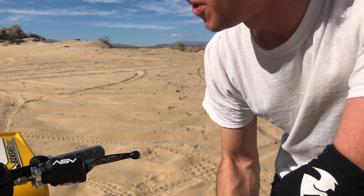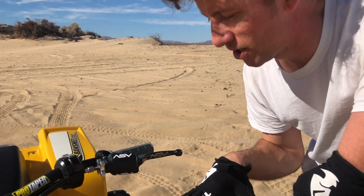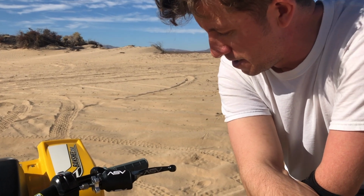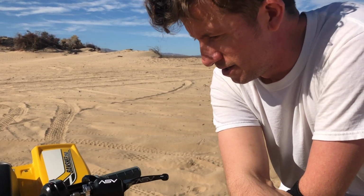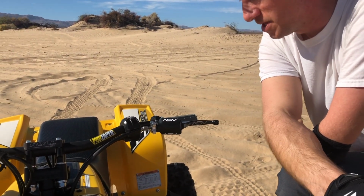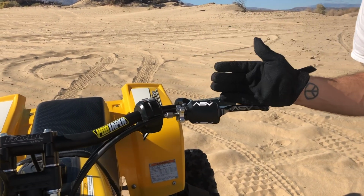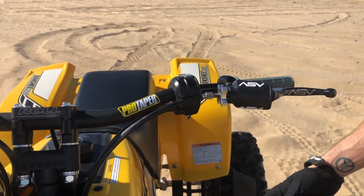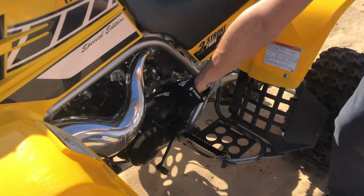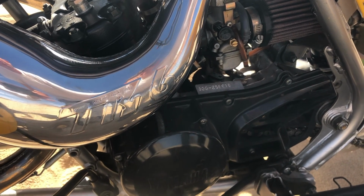Like I've been riding it. I rode it from my brother's house to here. It's about 20 minutes. It's been working fine, and now it's starting to kind of mess up a bit. It's really hard to grab neutral for some reason. I'm just wondering what the issue could be, because it was perfectly fine when I had the stock bars, stock lever, same clutch cable, and if you look, everything is functioning pretty perfectly. The clutch is definitely grabbing, but it's just acting kind of funny.